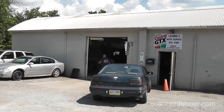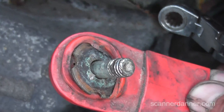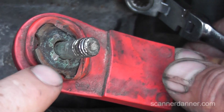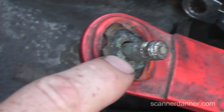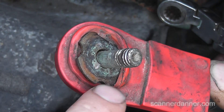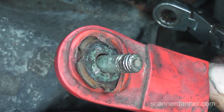I do a lot of Pete's electrical and electronic troubleshooting here. So even though that cable was loose, guys, what happens with these is that corrosion that gets in between — that'll be your voltage drop. And again, you won't see it until you hit the key and load the circuit. What we want to do is get something — we need to clean in between and then tighten this back up.